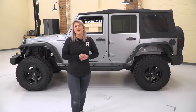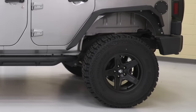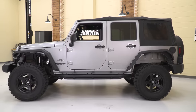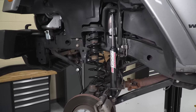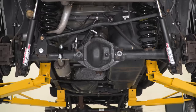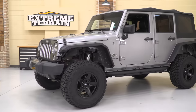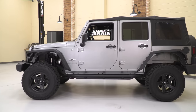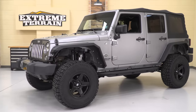Being a base suspension lift, this is perfect to get your Jeep up and off the ground and leaves room down the line for other upgrades to complement the kit. It features those 9550 VSS shocks that are nitrogen-charged, perfect for a split between the trail and the street, giving you stiffer dampening for a very long lifespan. Not to mention, this will level out the rake of the front end, creating a stronger stance overall and the Jeep is gonna look a lot more aggressive.